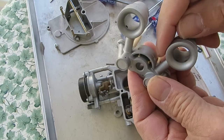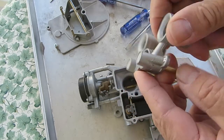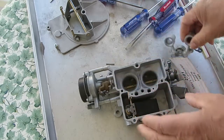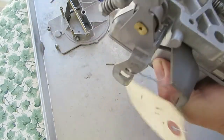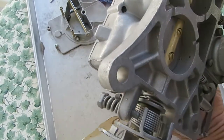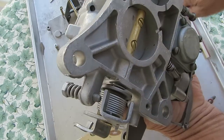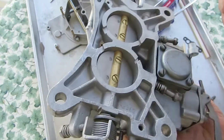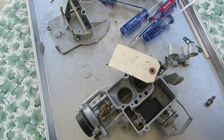This by the way is your discharge jet — when you press the accelerator pump. Make sure these holes are clear, and blow through this hole here; you should get air out through the idle mixture screw when you take it out. Make sure the hole here is clear and that you can see through it. There's the idle circuit — thank you.